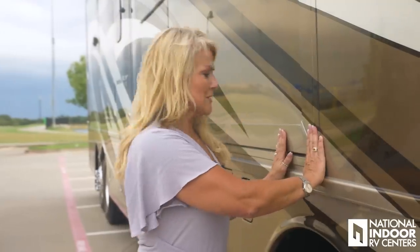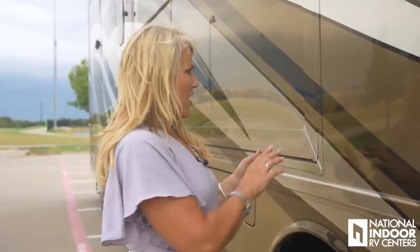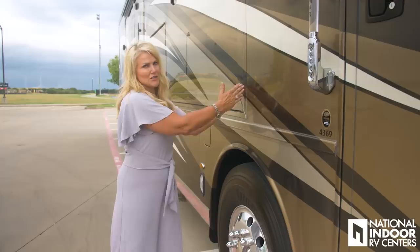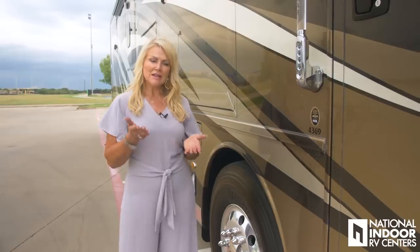Notice the flush-mounted slide rooms — you're not going to have an extra lip hanging over the side of the coach adding wind noise, making this very quiet. People ask me all the time: slides out, jacks down? When you're at ride height, your box is square — there's less than a finger's distance clearance. If you put your levelers down first and then try to take the slides out, they'll be off and could rub at the top or bottom. So you want to extend your slides first, then put your jacks down. When you go to leave, do it in reverse: jacks up, then slides in.